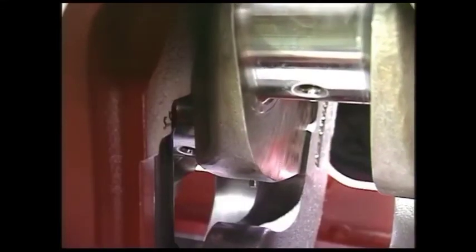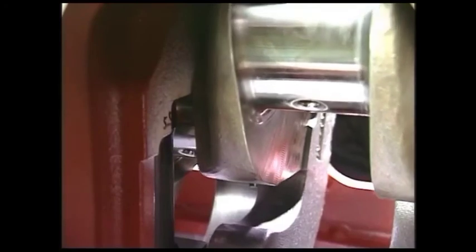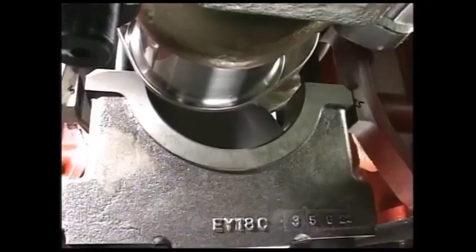Covering the assembly of the main bearing, turn the flywheel to lower the oil hole in the crankshaft below the center of the crankshaft, then set the first main bearing.